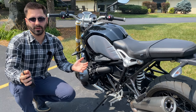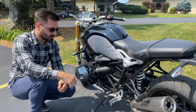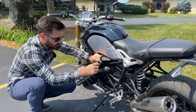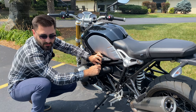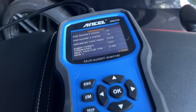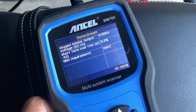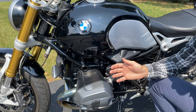You may not be able to turn off ABS, but did you know that this bike actually has an OBD2 port? It hides right here behind this little fairing. You can unscrew it and then with a $15 adapter — they sell them on Amazon and they seem to work pretty well — you can scan the bike. You can see live data, and if you have BMW software or a fancy motorcycle scanner, you can do even much more.